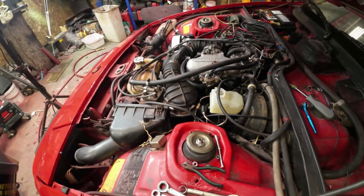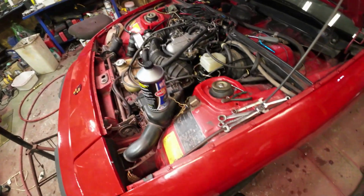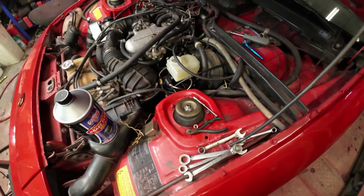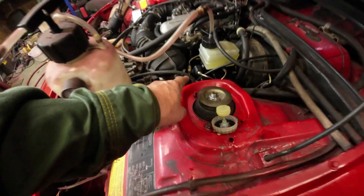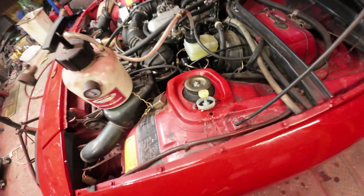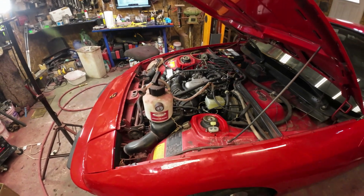So I'll fill it up with fluid and then pump the thing a bit, and then I'll bleed it, I hope. I might have to loosen one of these things here to bleed the master cylinder, but maybe not. We'll just see. Now, I opened up that one and let it drain through a bit, and that one there too. Then I checked the brake pedal, and it's got lots of brake pedal. In fact, a really nice brake pedal.